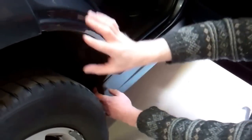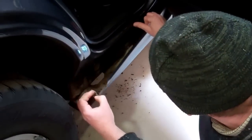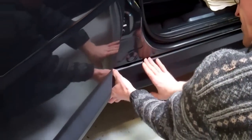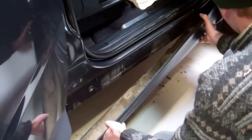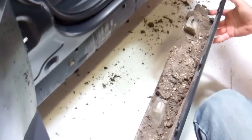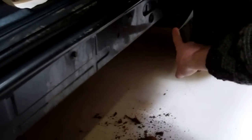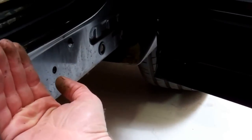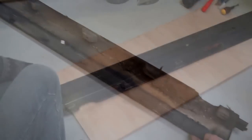Starting at the back wheel arch, you've got a nice little grip you can get on to start popping it away. Work along in the same direction. Then at the front, you've got this little tongue section that pokes forward into a little docking station in the front corner plastic. So pull them away first, drop it down at the back, then slide it backwards. That's the seal removed. We've cleaned the seal — you can see there are three slots we've now got to cut.